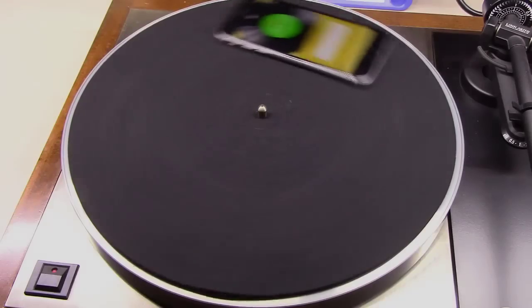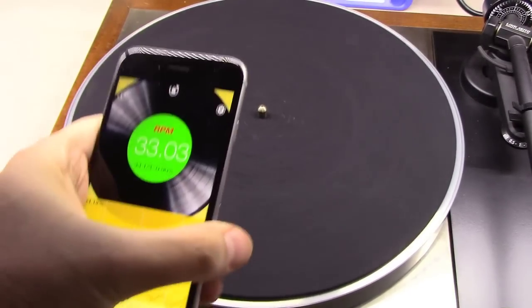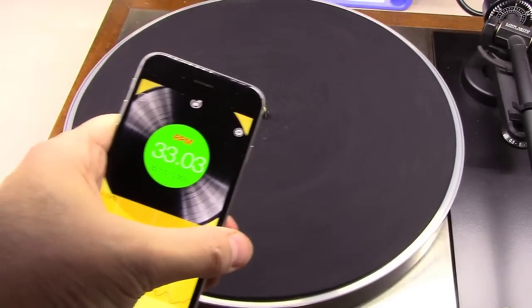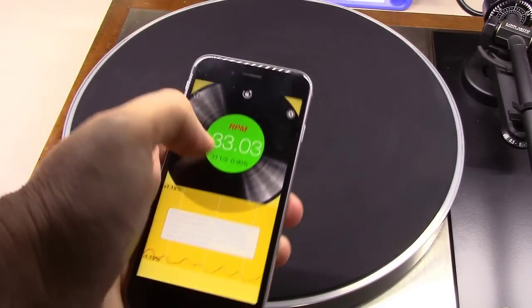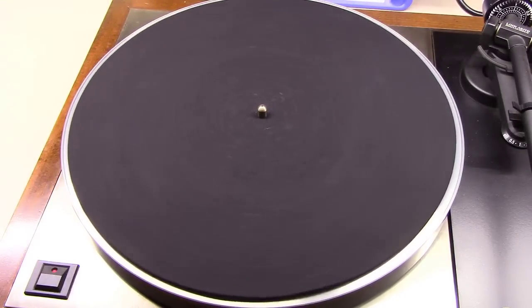So, okay, I've been letting it run a couple hours now, and I tried a different little app. This is called RPM, and basically the center of the record turns green when it's within spec. It's running at 33.03, so 0.03 away from being absolutely perfect. In other words, well within spec, and you would never hear the difference. So at any rate, happy with how this thing's turned out. We're going to get it boxed back up and get it back to the customer here soon. Thanks for watching, everybody.